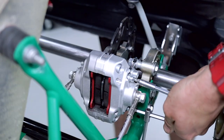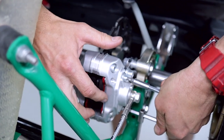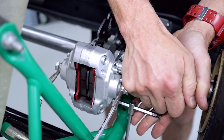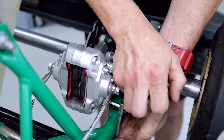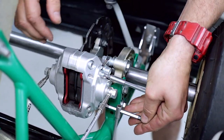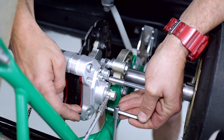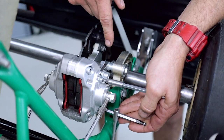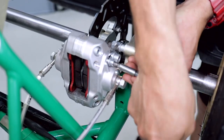When you're installing your brake shims, there's two ways you can do it: the easy way and the hard way. The hard way is to push the brake pad off and slide the shim in behind the pad and the piston by pushing a couple of allen keys onto the bolts. These are the pad retaining bolts and they've got little springs on them, so you can just push them in and then slide that shim in. You've got to push both of them in at the same time, and you can get it done but it's a bit more of a mission. What I like to do, which is the easy way, is remove the brake pad retaining bolts and springs assembly.